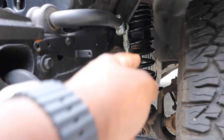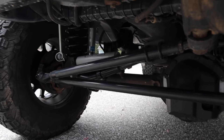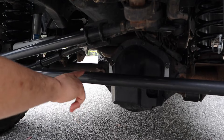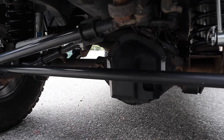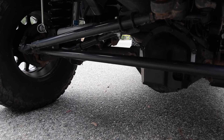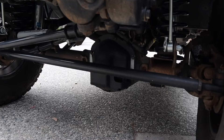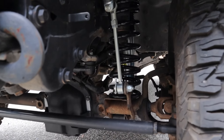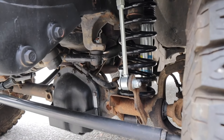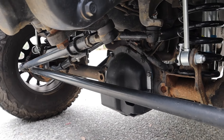Underneath, you can see he upgraded the springs and the shocks, the heavy-duty steering, the tie rods, and the track bars. This is all upgraded, so if you were to knock into something it won't bend and it won't break easily — it's going to take a lot of force to hurt that thing. It has the lockers front and rear, it has a 4-to-1 low transfer case. All the bushings, arms, tie rods, and track bars are new. It has the Bilstein shocks with the JKS springs.